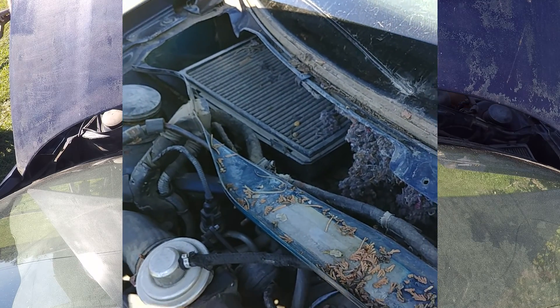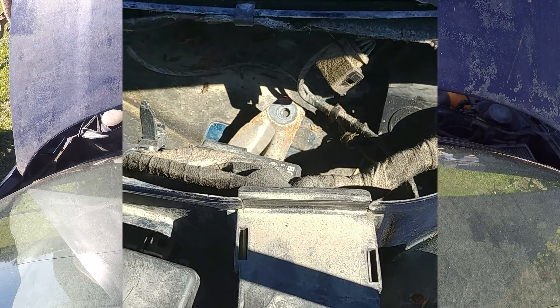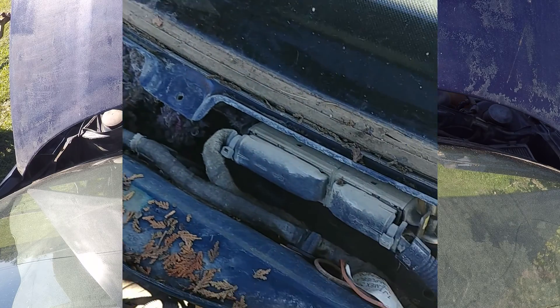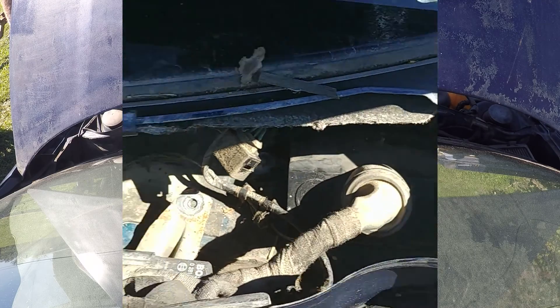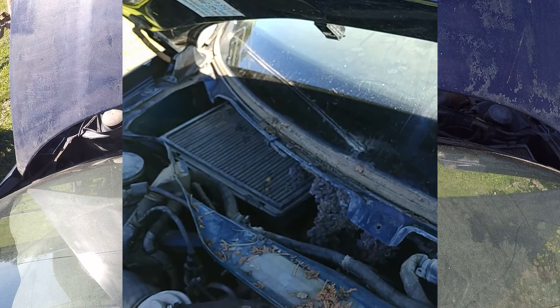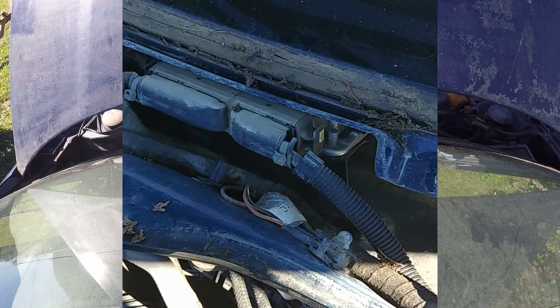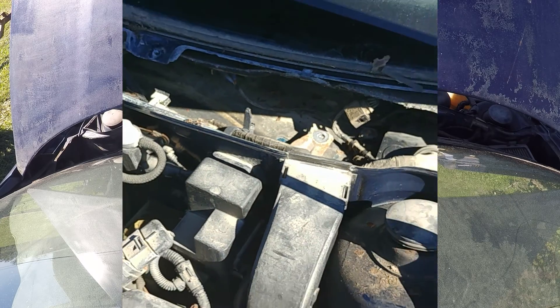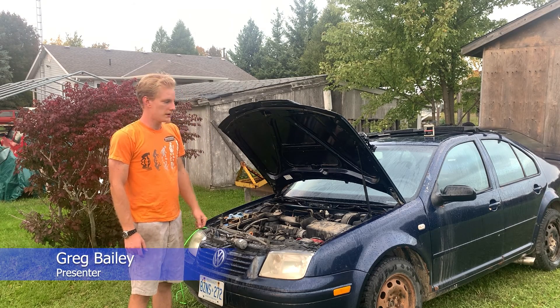That's how I'm going to leave it to do the windshield. Like I said, I had a bad experience with them putting the window in and reassembling the wipers last time so I'm not going to have them do it this time. The weather forecast is supposed to be good so I'm just going to take this over, use compressed air to blow out all the debris, and we're pretty much ready for the windshield. If you are leaving the cowl out for an extended period and there is going to be weather, water will go right past the cabin air filter and right into your floor, so either set the cowl back over or figure out how to tarp the car.